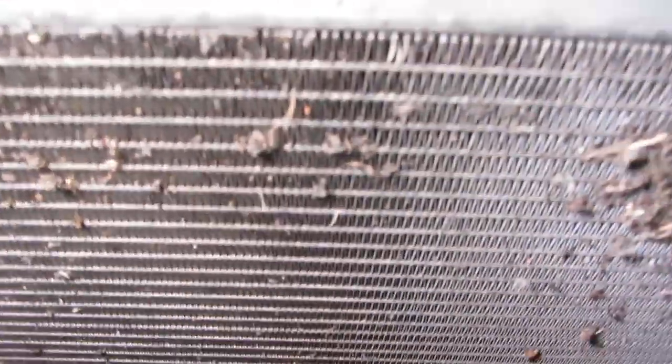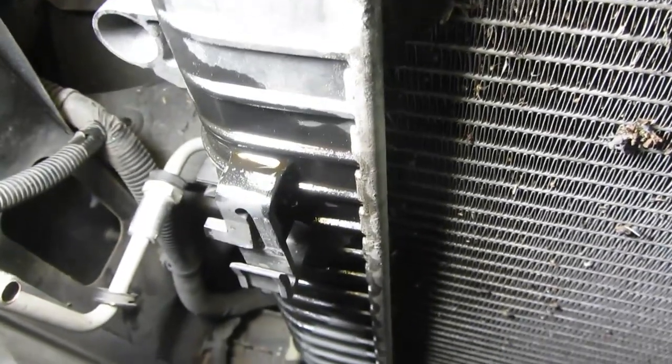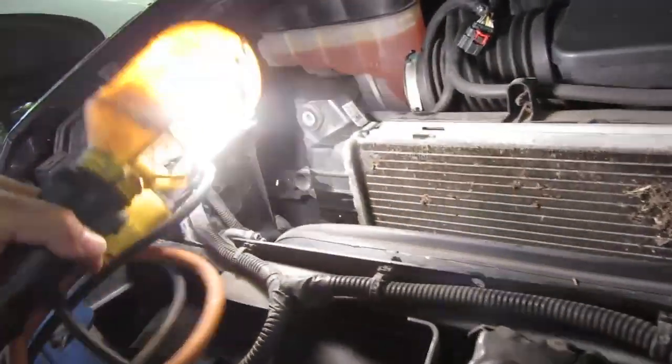And if you look in here, this is going to be pretty disgusting. Look at this radiator — and then down here. So what we're going to do is get the vacuum cleaner and clean all this up. We're not going to clean all the trans fluid off until after we get it all put back together. But I did notice — and I let him know — that his trans fluid is brown instead of red. It's probably needs to be changed. It has never been changed at 160,000 miles, so it's definitely due. And there you can see it — it is definitely brown and not red.